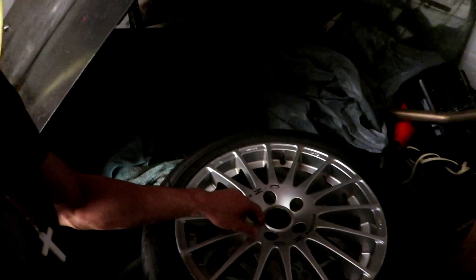What I'm planning on doing today is putting my rims on. The rims I plan on putting on are these OZ Racing rims right here. The only problem is you need longer studs — the stock studs don't fully come through the hole of these rims. So I bought extended studs. What we're going to do is take all the current rims off, take off the wheel studs, and then put the new extended studs that I bought, and I'll show you guys those after I take the old ones off.